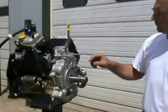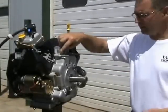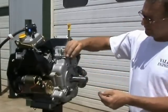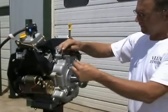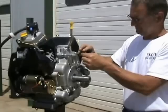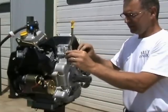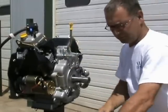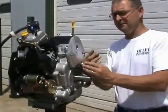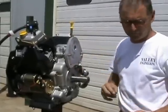While we were out, we went and installed our studs, put on the lock nut and the washer, and drew it down. The next step is to put on the non-locking nut first, and a washer — a non-locking nut and a washer. The reason is so when you put your bracket on and you're adjusting for your alignment, you can use the non-locking nut to move it back or forth and line it up.